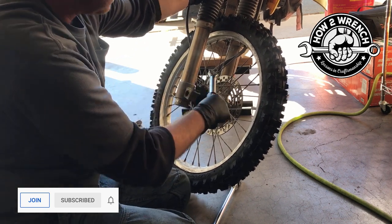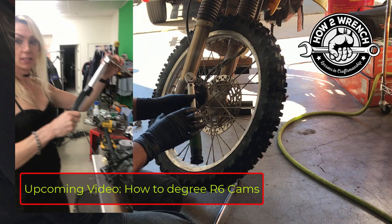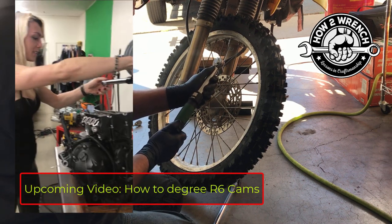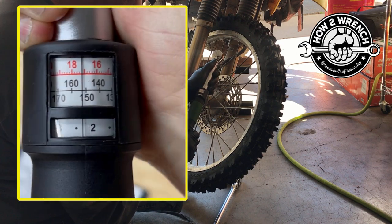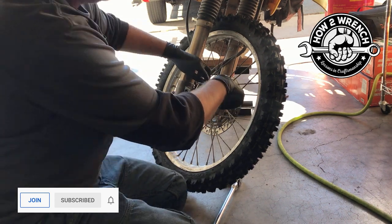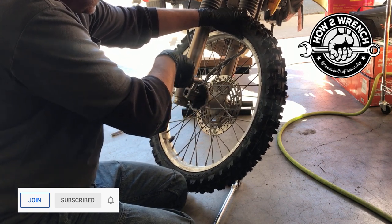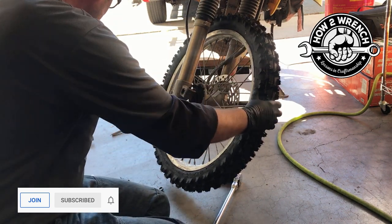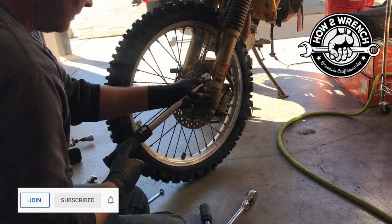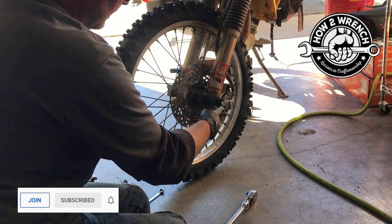The August Racing team was here and we loved the feel of these wrenches on the first use. Going to full torque now — the scale has small increments: two, three, four, five, six. There's a lock so I can lock the setting in place. That's torqued. Moving to the axle next at 32.5 foot-pounds — I'll go just a little below spec first so I'm not spinning on the pinch that I'd otherwise need a hold tool for.